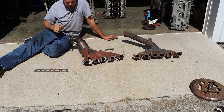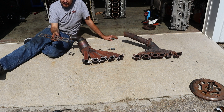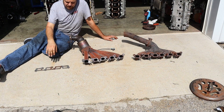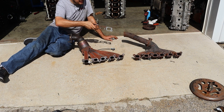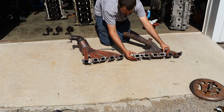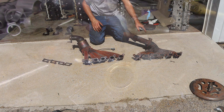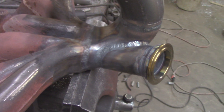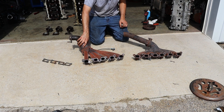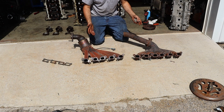Let's talk about the exhaust manifolds. I don't have a 4-cylinder exhaust manifold, but I do have a flange for making an aftermarket turbo manifold, so we can use that for comparison. The 5 and the 4 are just a subset of the 6-cylinder flange — it matches up exactly the same, same bolt pattern, same everything. Sometimes we take the 6-cylinder manifold, cut the flange off, and weld an elbow onto it to mount our turbo. With the 4 and 5-cylinder, that's a little bit harder because it has an integrated catalytic converter, but it could still be done.